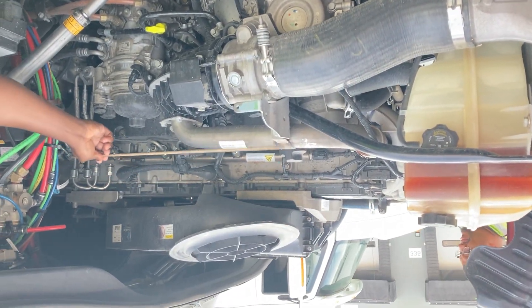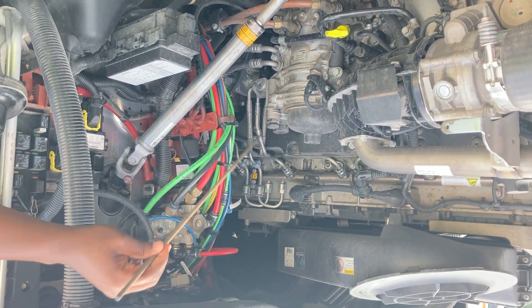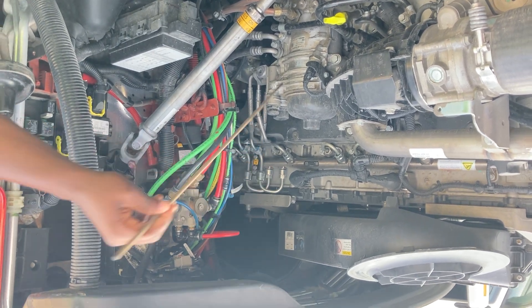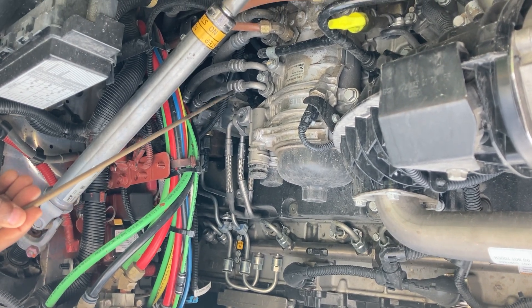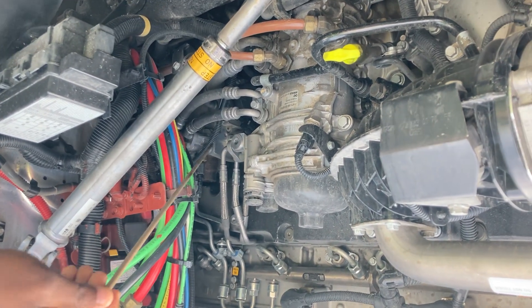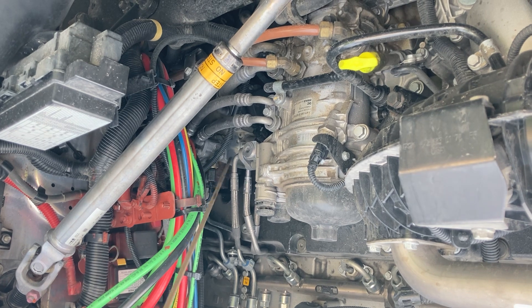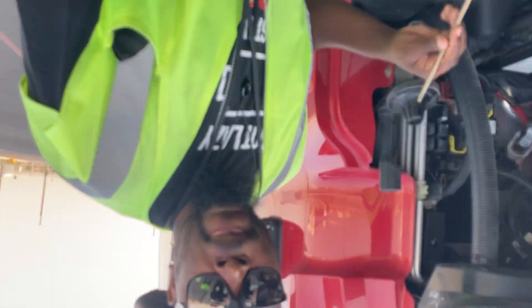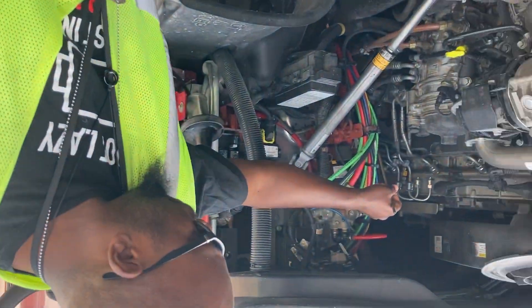Following my Z pattern, we come over to my air compressor, which is right back here. My air compressor is properly mounted with nuts and bolts present and tight. It is not cracked, broken, or audibly air leaking — we say audibly because it's an air component, so we're listening for audible air leaks. My air compressor lines and hoses, mounted with couplings that are present and tight, have no abrasions, bulges, cuts, dry rot, or audible air leaks. The air compressor is gear driven — when the truck is running, it builds up air pressure, and when air pressure is lost, those gears turn to build it back up.